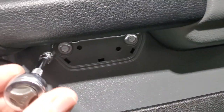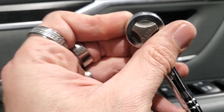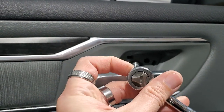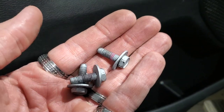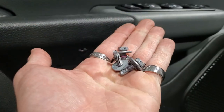Next, you want to start with these two 10 millimeters — this 10 millimeter up here. I recommend using a ratchet with a 10 millimeter socket to break them loose. This one up here is very, very tight, so definitely break them loose first, get them down about 10 turns, and then you can go ahead and use your drill with a 10 millimeter on it to take them out. Here's the three 10 millimeters — one, two, three. All those are taken out.